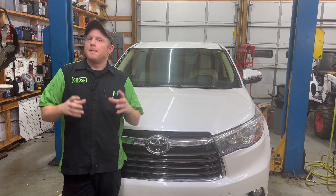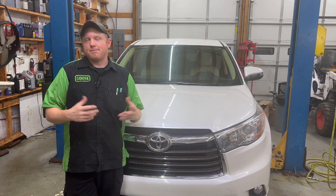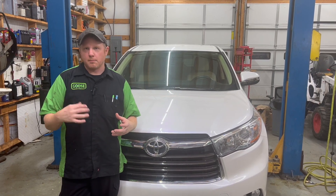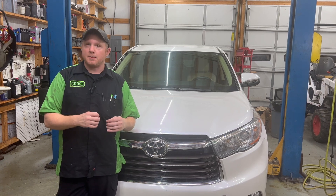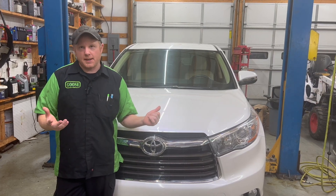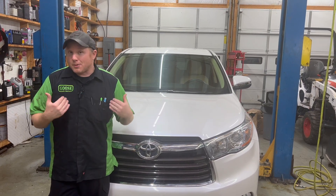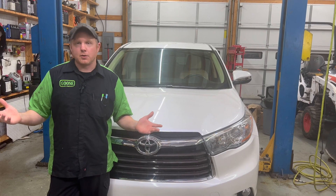That's going to wrap this one up, guys. We went for our road test and everything was fine. So the million dollar question is, should you do this? Toyota says that this is a lifetime fluid, which means it's good for the lifetime of the car. But it's also hygroscopic, which means that it will absorb moisture. The problem with absorbing moisture — even just from humidity — is that as that condenses inside and becomes water, the boiling point of water is 212°F. Transmissions can get above that, and as that water boils you start to get shuddering issues, not to mention debris going around. I do my personal cars around 100,000 miles, which means you might have to do maybe two of them over the lifetime of the car.